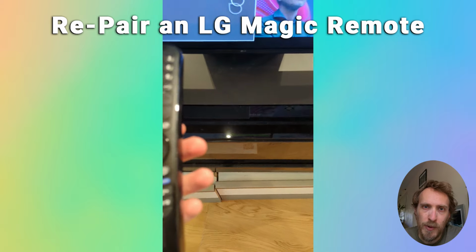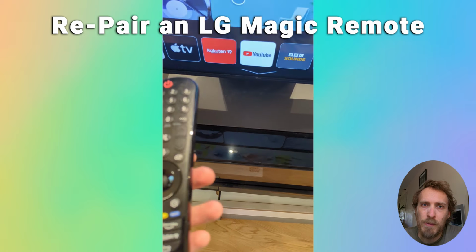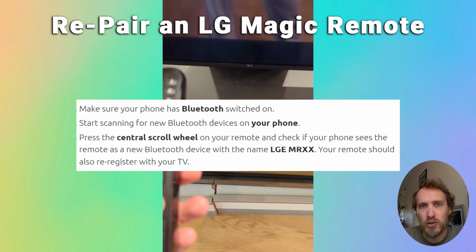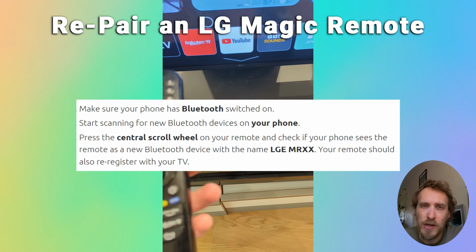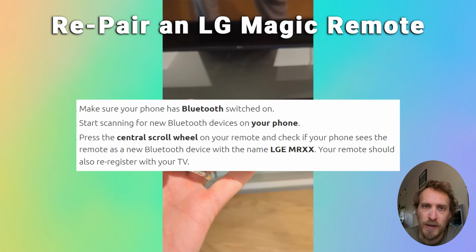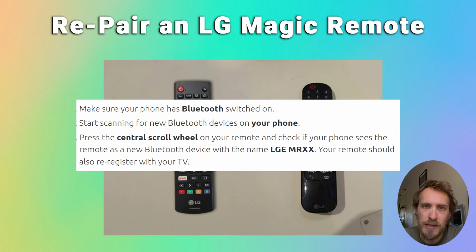You can confirm whether the Bluetooth is working within the remote by opening up your phone and clicking Pair New Devices in the Bluetooth menu. And then when you press the central scroll wheel or any other button after deregistering your remote, you should see your remote appear in the Pair New Devices menu on your phone. It will have a name like LGE something. And if you see that on your phone, then you know that the Bluetooth is working with your Magic remote.